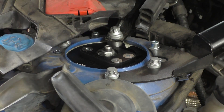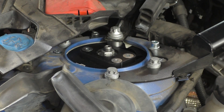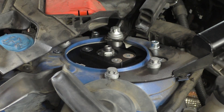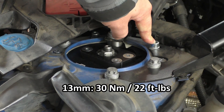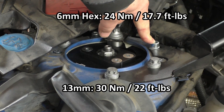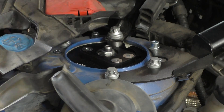As you can see from my setup, the two bolts closest to the engine are the ones that would interfere with the sliding camber mechanism if they protrude below the plate, so those two must use the included Millway bolts. The other three bolts I've swapped out for the OE ones. Also, because these are only grade 8.8 instead of 10.9, the torque spec is lower: the OE spec is 30 Newton meters (22 foot-pounds), but with the grade 8.8 bolts you're not supposed to torque past 24 Newton meters (17.7 foot-pounds).